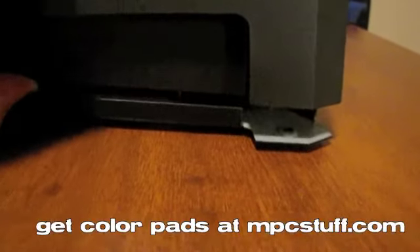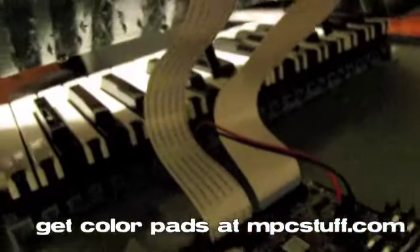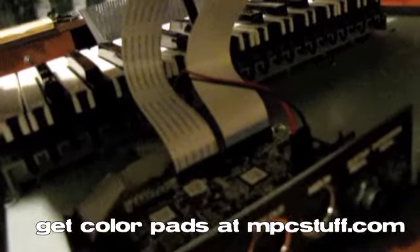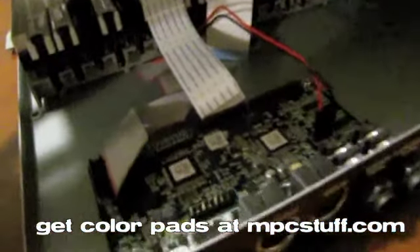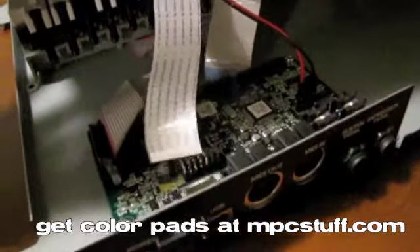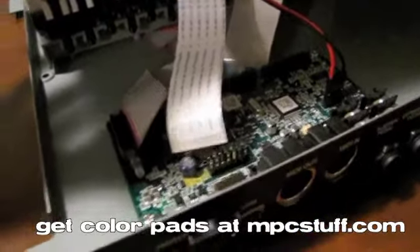What I'm doing here is I'll show you by opening up the back side where the ribbons are. See those ribbons that are attached to the top right here? We just need to get those ribbons out of their respective holders. That way we can pull this top panel off and get out the pads. I just pulled up both ribbons — the ribbons are going to come out of the bottom of the board, not the top side. These ribbons just pull right out. Don't pull too hard, but they will come right out, and when we put them back in we're just going to slip them back in.